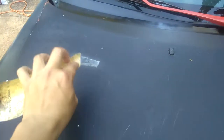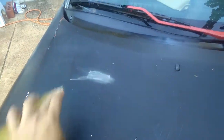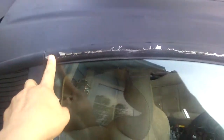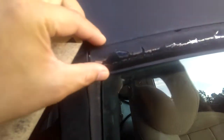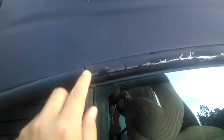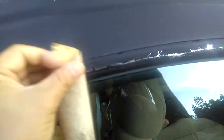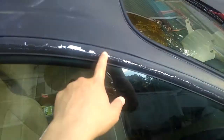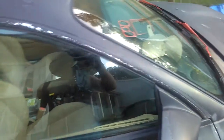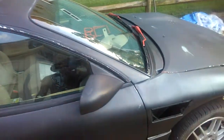See this spot right here — I need to sand this out good, smoothly, and take out those tape residues. Just use some razor because it's peeling — cut it out. I know I should have bought two from the junkyard; the other side looks new and this side looks old. But if you don't want to change it, just take a razor and cut it, peel all this out, and go over with sandpaper so it smooths down. Or you can paint it black before you take it to the paint shop if you want.